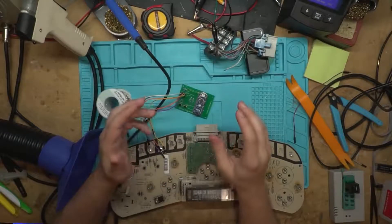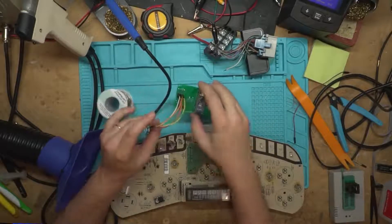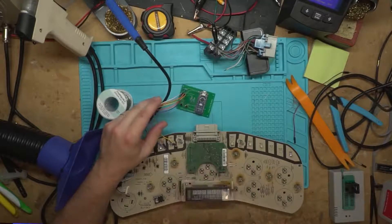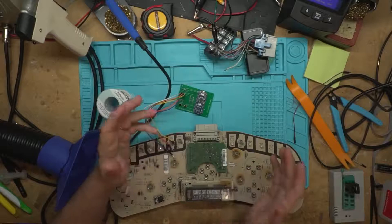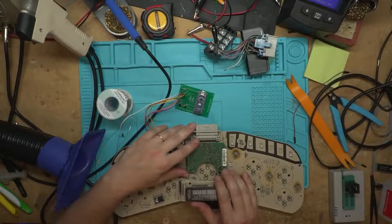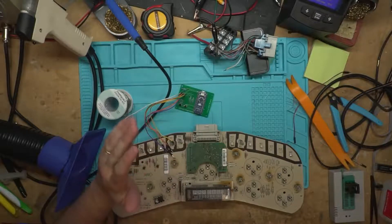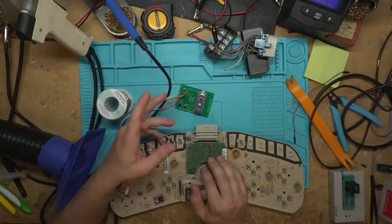Today I've got a video I've been meaning to do for a while. I'm going to go over using my DIY EEPROM programmer to program the EEPROM on the instrument cluster, which covers your odometer and a couple of other features. This is going to apply to your 2000–2002 model instrument clusters. The 1999 uses the same process for getting into it and the odometer is the same, but everything else in the bin does not apply to 1999, so we're focusing on 00–02.